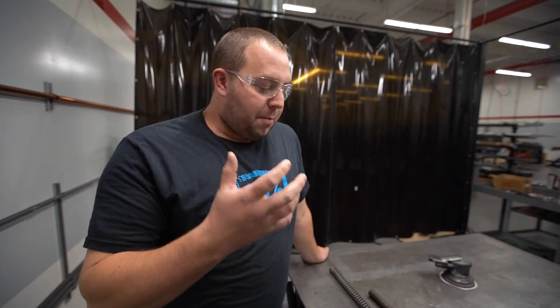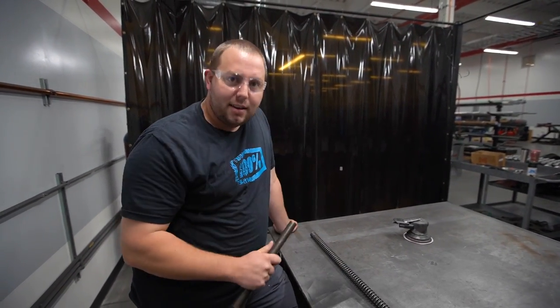I've got some work to do because I've got a pretty loud knock when I start my bike, so I think the bottom end might be the culprit. Now, we all know the TTR 225 is the absolute best bike of the bunch, except for one small thing: the suspension can't hold its own weight up. On my tight budget, I've got to stiffen up the suspension, hopefully keep the front end up so it doesn't dive under braking, downhill drops, or me even just sitting on it. I'm just going to cut them up, put some solid steel tubing in there and see if it works.